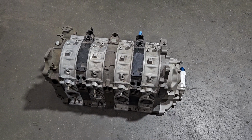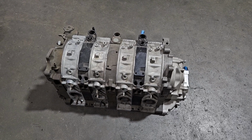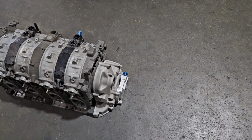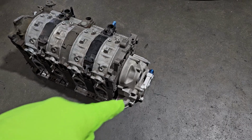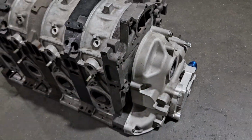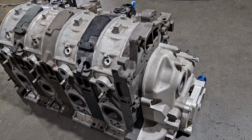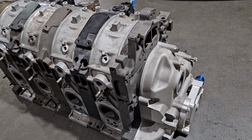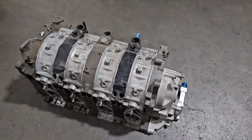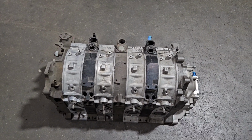There's some variations. You can go side port, you can go semi-peripheral port, you can go peripheral port. I've seen them oiled externally when it comes to external dry sumps. And I've seen people run the factory Formula Mazda dry sumps. So I think there's a lot of variation to these builds at this point. And with the billet industry also really starting to evolve, there's a lot of billet 3-rotor and 4-rotor combinations available.